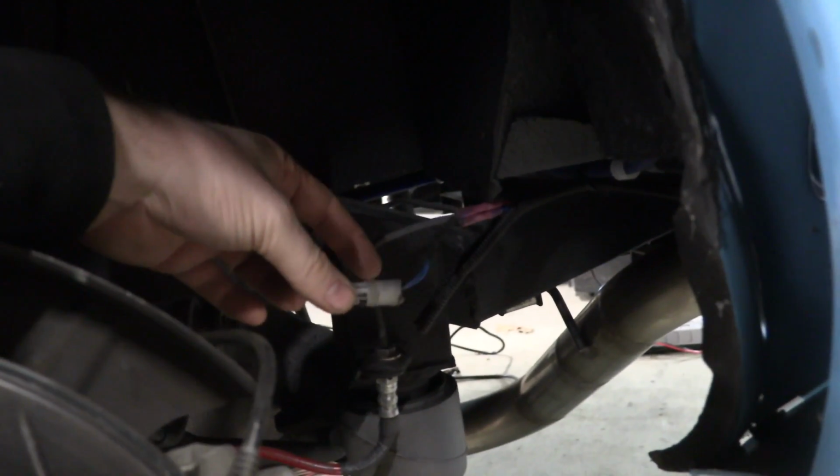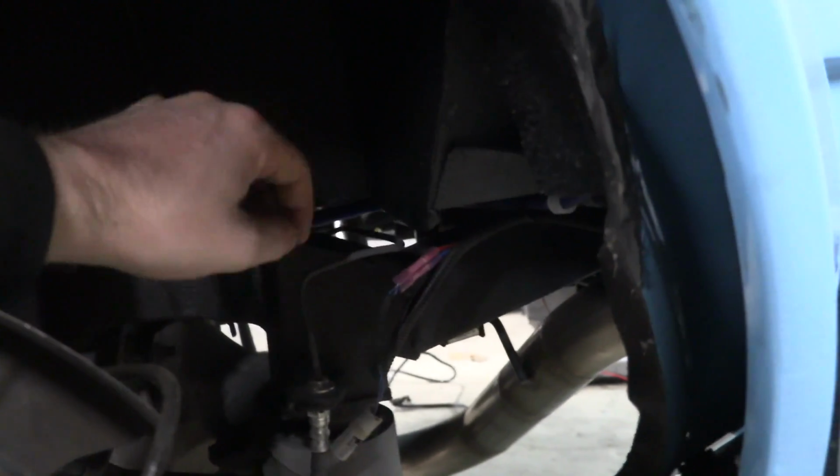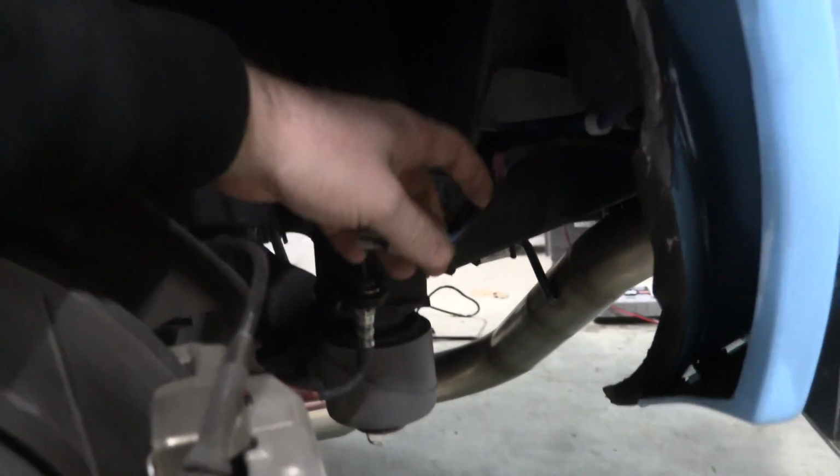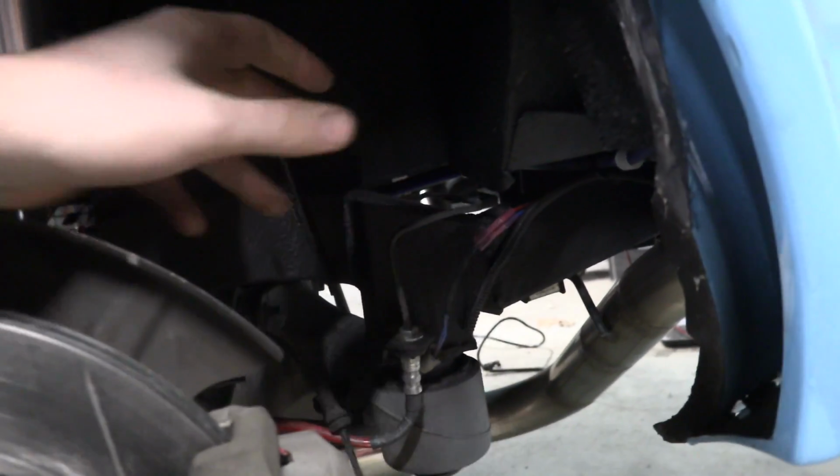Sometimes some sensors do use cable length in some scenarios, but on most cars cable length does not matter. So I'm definitely not going to consider that as too much of a serious issue. So that leads me to thinking that there's probably a fault further upstream. So jumping into the back here, I've been trying to diagnose and look.